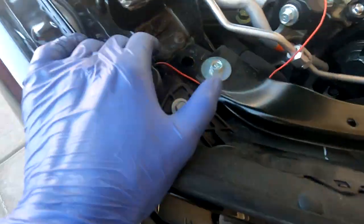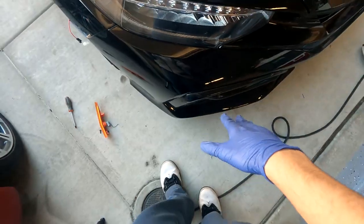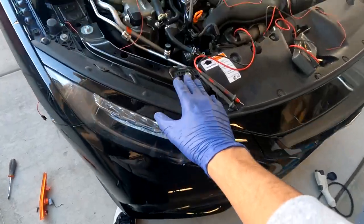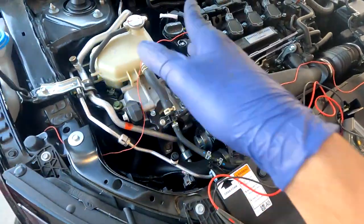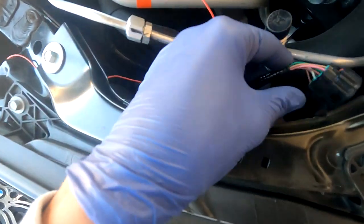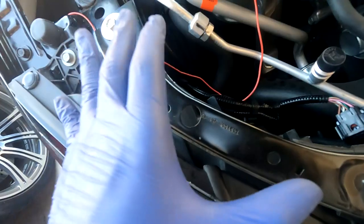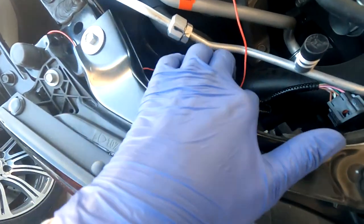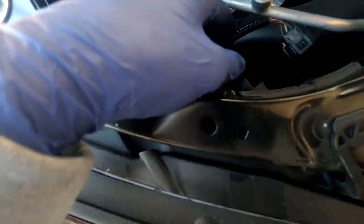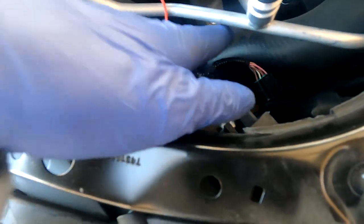I've got the wire fed through with a little bit sticking out up top. There is an access route underneath, but to use it properly you'd have to take off the front bumper, so I'm going to wire it properly when I eventually have the bumper off for the taillights. For now, before cutting to length — because once you cut it you can't go back — I'm going to strip some of this wire to access the green wire and T-tap into it. Actually, a better option is to tape the new wire along the existing wire and tap it in right here so I don't lose the mount.